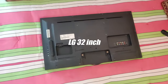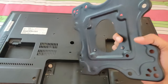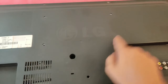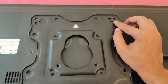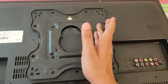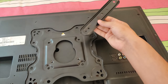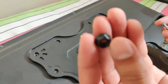So this is the TV which we have to install the wall mount on. I have removed this plate from the wall mount, and we will attach this plate to the TV. The TV already has two holes here and two holes here. The plate has matching holes here and here. The other two holes are not going to match but we don't need those, because the wall mount is large enough. If your TV is bigger you will need to use this plate. For this we will take the smallest bolt or screw, and this is the nut that came with the TV.